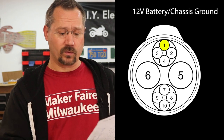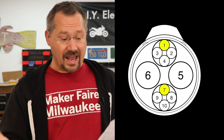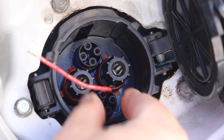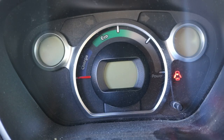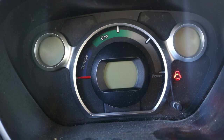We can actually just run a jumper from pin one — the topmost pin — to pin seven, at the top of the bottom grouping of pins. That will ground it and activate our proximity signal. Let's look at the car and see if we can drive away with those pins jumpered. We put the wire in, go to the front of the car, put the key in and try starting it — and we get our flashing plug message and we can't go into drive mode. So that's pretty cool: just jumpering those two pins together keeps us from driving off.